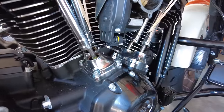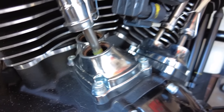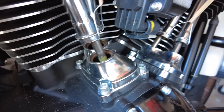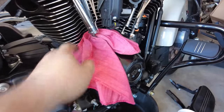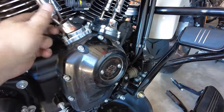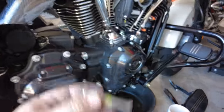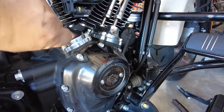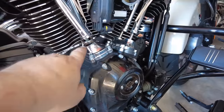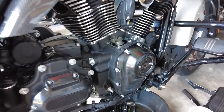I've got it to where I need to be. If I rock this back and forth - see how that moved up? It's right on the bottom lobe now. So I can cut that - there's no tension on that push rod. First one's cut. I've successfully made this motor completely screwed until I put it back together. I'm going to leave the tube there, shove a rag back there just trying to avoid my bolt cutters nicking something. Make sure this one is all the way down, and then cut that one.